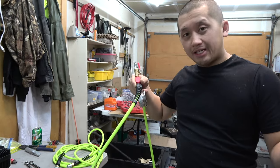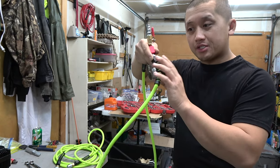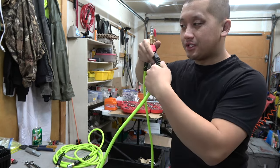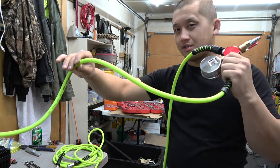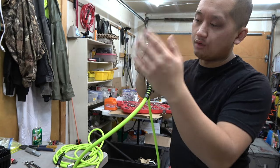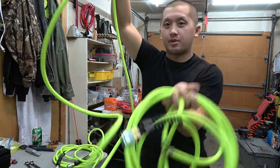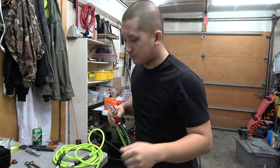I think that's good. For this hose that goes to the two lines, I suggest next time you guys hook up this first and then hook it onto the intake manifold and then clamp it down to the T, so that when you turn this, it just makes it easier. If that makes sense, guys. So next time, install this in first before you install it to the whole two line, just so that it's easier to spin. It's not a hassle now. When you're spinning it, you just have to spin all this just so that it's going around the right circle. So, little things to think about.